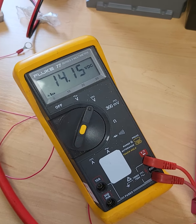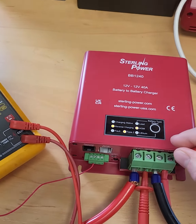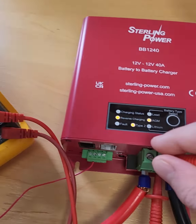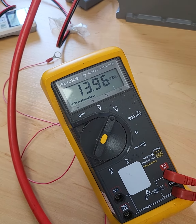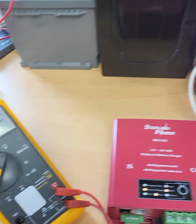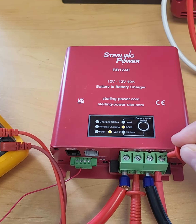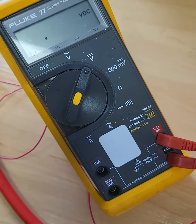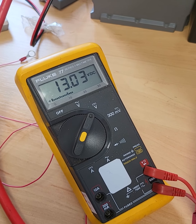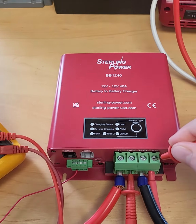That's what's going on at the leisure battery. Now I'll show you what happens if you put a load on the leisure battery to bring it down, so the unit stops taking energy from your leisure battery to keep your starter battery topped up. At the moment it's still in reverse charge — leisure battery is healthy, up at 14V, starter battery is at 13.3V. If I turn an inverter load on now — that's connected to a 2-kilowatt fan heater — that voltage should just collapse at the leisure battery. The reverse charge LED has turned off, so the starter battery is starting to drop off, and we're down to 12.8V at the leisure battery.